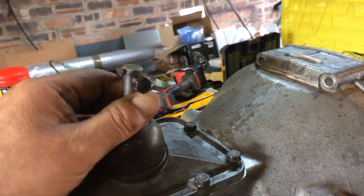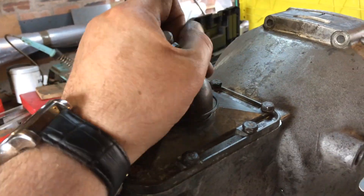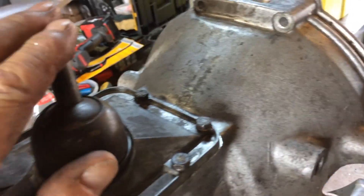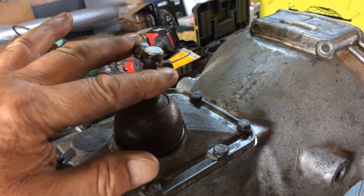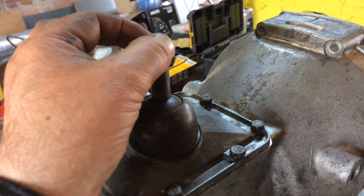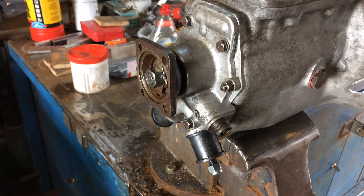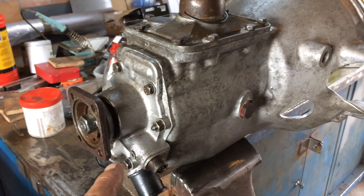I declare that a success. I'm now able to get it into reverse gear without having to lift it. It's not very well clamped in at the moment, but it now has all the gears. There's quite a bit of the shortened gear stick of course, and a remote gear change rod comes out here that bolts on. I had to straighten the gear lever a little bit and drill a hole in it, then the yoke bolts onto that. I've got new mounting rubbers for the back, but I'll need to make a mounting bracket to mount it into the tunnel, because this has a different mount compared with the earlier Reliant Regal box - this is a Reliant Robin box I think.